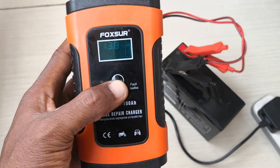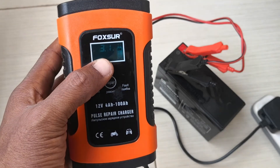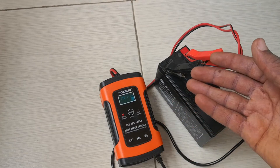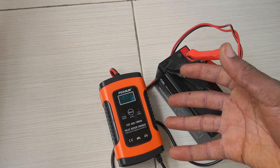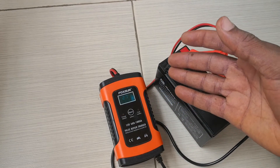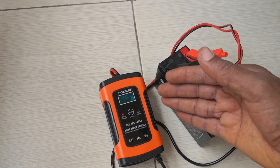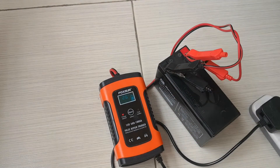After the repair duration, push the button again and it goes back to regular charging. It's advised that when it displays the full sign, you still leave it for an hour to provide float charge. This device charges a battery in three phases: first is the constant current phase or bulk charge phase, where most of the lost charge is restored; then it moves to constant voltage, where it's topping up the battery — after the bulk charge the battery may be able to start your car. This topping-up phase is important to ensure the voltage goes above the level at which sulfation occurs. Lastly, float charge makes sure it hits 100%.